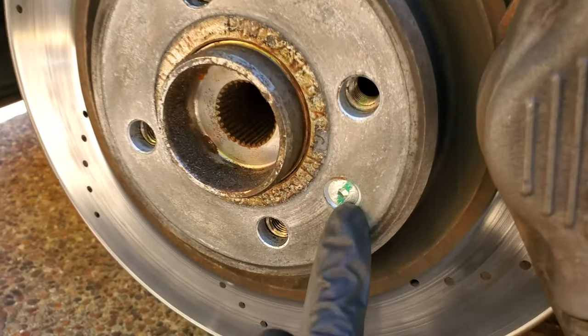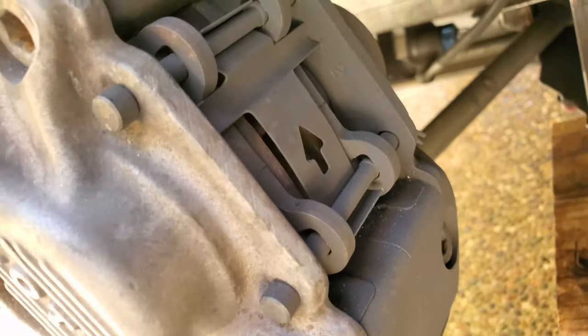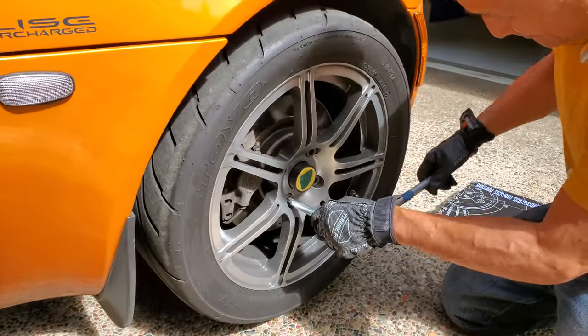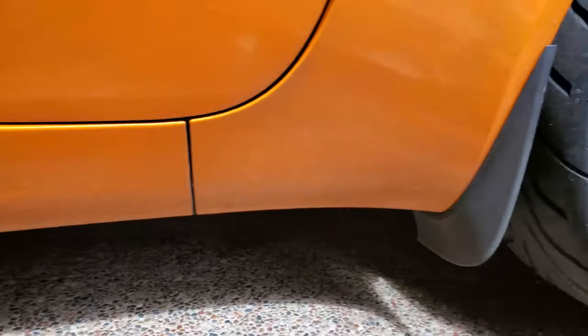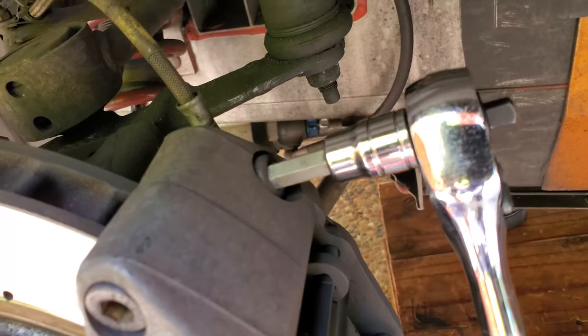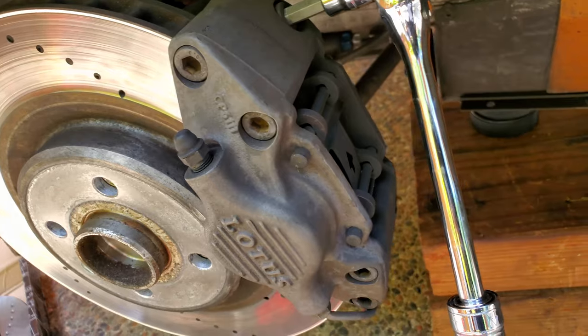This is now pretty much ready to take apart and throw the new pad and rotor on. Looks like the rotor is held on with one little allen bolt to keep it on the hub. And the pads look like they're held in with one single clip with two little rods — pull out the clip, rods come out, and the brake pads pop straight out the top. We decided to work on the other side at the same time. The Lotus is so stiff that the other side, at least the front, came off the ground with just the other side jacked up — pretty amazing. I'm going to pull the caliper off; it's held on with just two little allen bolts up top, just like a racing caliper like a Wilwood, where the bolts go through the caliper into a bracket.